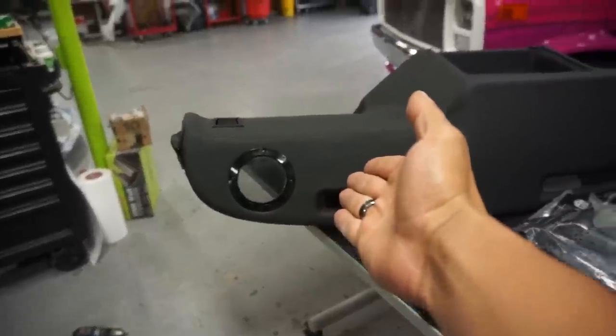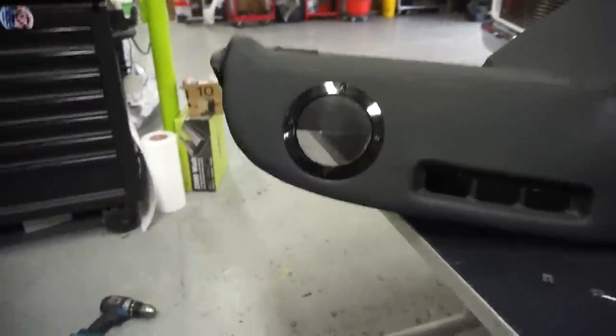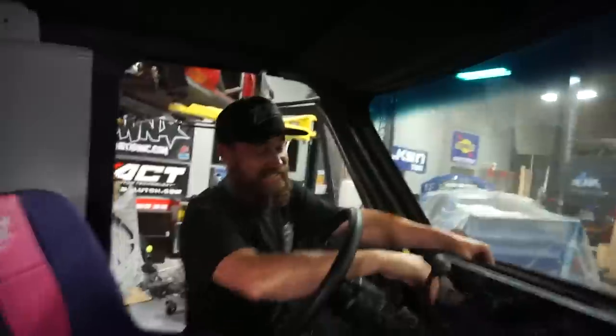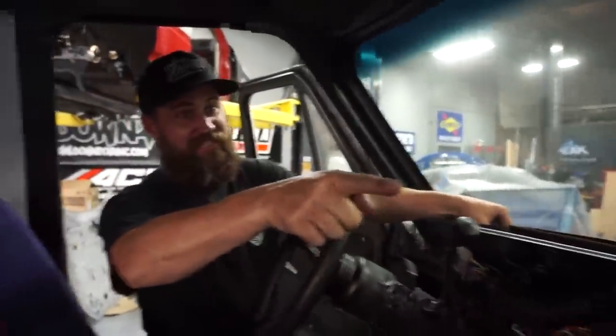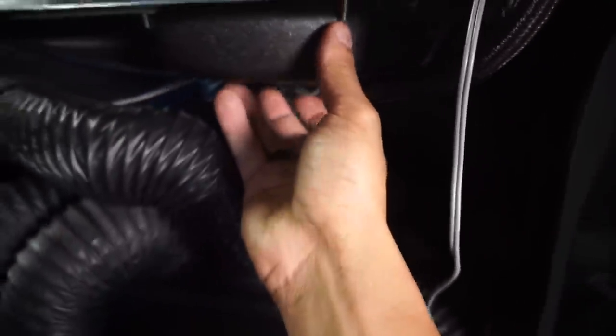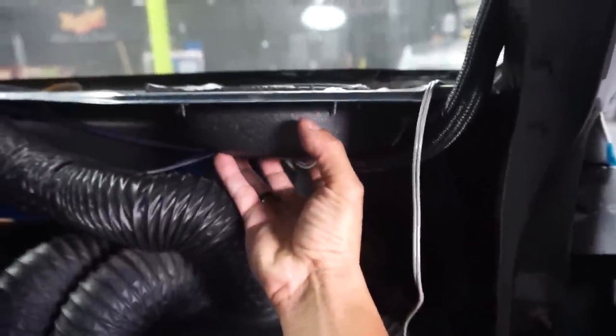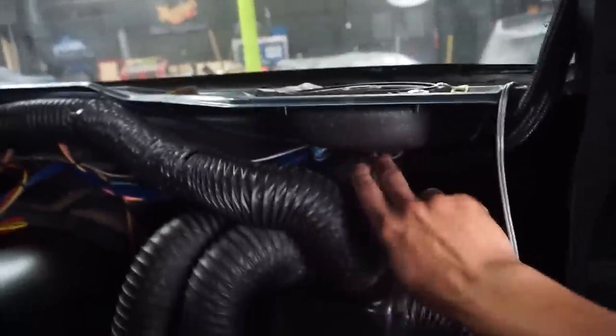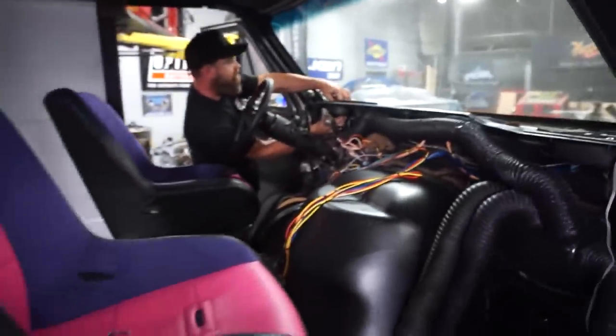We just got the speaker covers on both sides and the hole is made. Mickey is over there working on the van speakers. This is the foam that goes under the speaker — instead of the speaker bouncing off everything behind the dash, it literally concentrates the sound so you will hear it a hell of a lot better. These vans are a challenge because it's such a big open-air space and they're very rattly, but it's going to sound good.